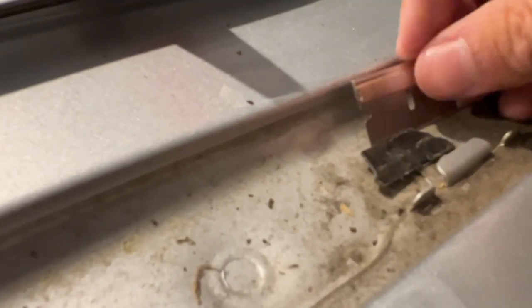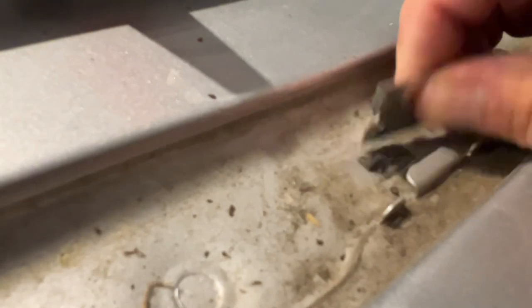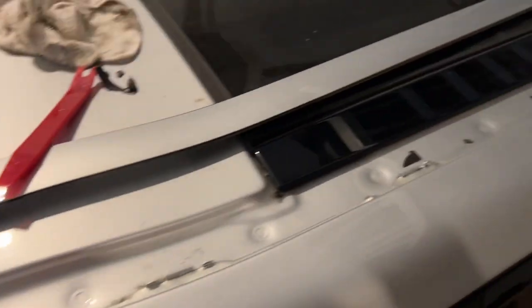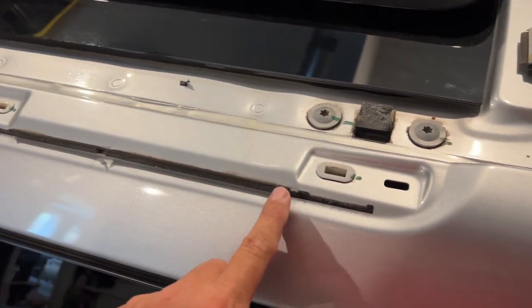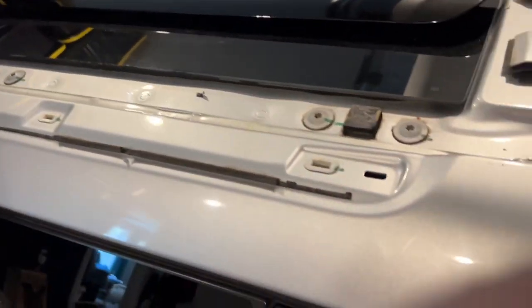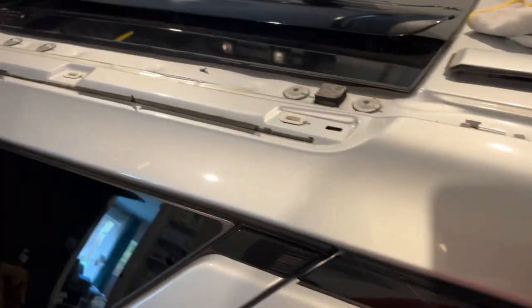This is not like a 20-minute job by any stretch of the imagination, but you can see how it starts to come loose. You'll need to go back and get the little bits that aren't cleared away — you don't want to leave anything behind there because more adhesive has to go there. You're also going to find a rubber seal on the outside. Part of it will come off with the trim piece, but you need to remove this entire thing because exactly where it's sitting is where your new adhesive is going to sit.